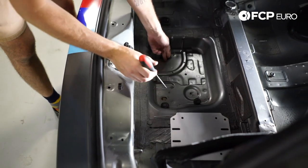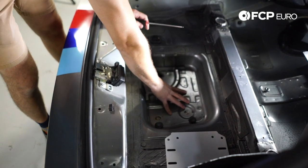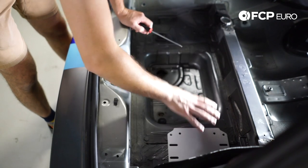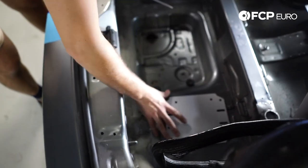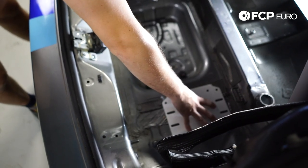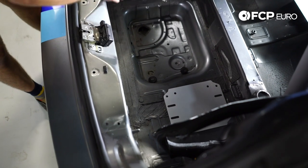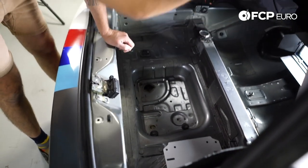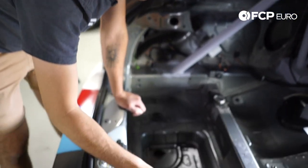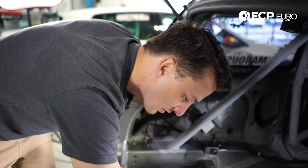My concern is there's a heat shield right here and the muffler lives right under here, so I know this portion of floor is going to get pretty warm and the aluminum is going to transfer the heat into the battery. So I think it's a better option to actually put the battery up top here. We're going to lose a little bit of that center of gravity, but we'll still have it in an easy access spot and we're not moving the weight around all that much. The other thing I'm considering is going opposite the driver — driver over on the left-hand side, battery on the right-hand side. That will balance the weight out a little bit on the back side of the car.